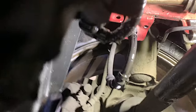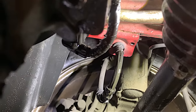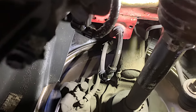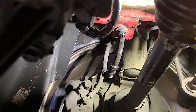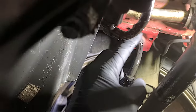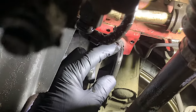Let go of the brake pedal now. Put your foot on the brake again — look at that, it's absolutely chucking it out. I have to say in all my years I have seen brake hoses leak before, but this one has got a flipping two-inch split in it — it's literally split.